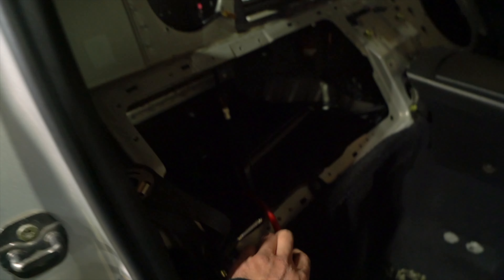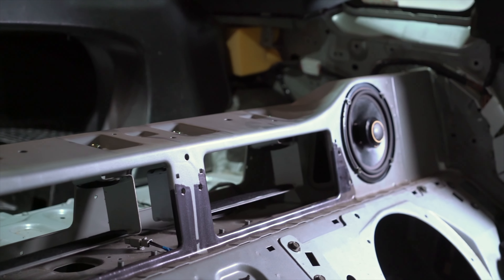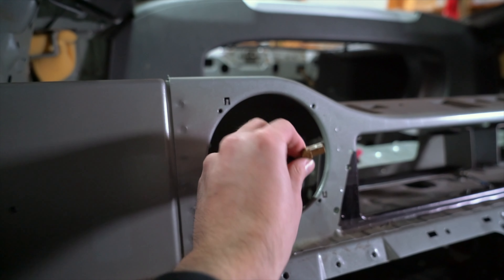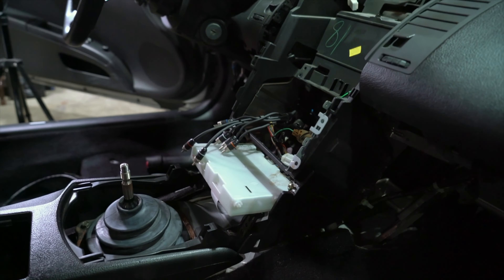Super happy with how I was able to get the wire tucked over here, running through that OEM wire holder I was telling you guys about, and run up through here into where the amplifier is. Once we get this pulled-back carpet put on, we'll deal with the amplifier and speakers next. Got one speaker in — just did a test run for this side. One interesting thing: the previous owner didn't use the factory wiring and had the speakers wired directly to the amps, which I think was causing issues because as long as I've owned this car these back speakers never worked. So we're going to cut this off, put on some connectors, and install the new six-and-a-half inch Pioneer speaker.